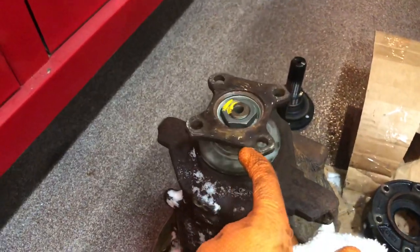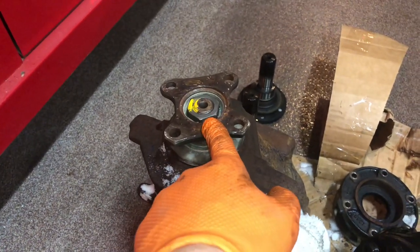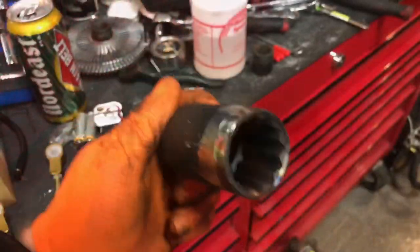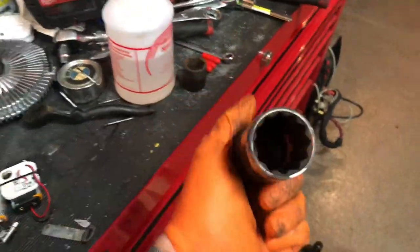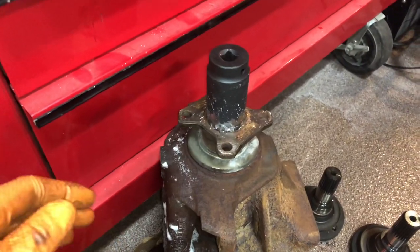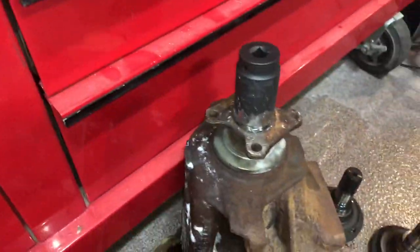Next up, I'm going to yank this out. I'm going to Google it first because I'm pretty sure this is reverse thread, and you don't want to mess that up because this is a crush sleeve and that gets bad. My 30mm socket is a thick wall and I do not have a thin wall axle socket, so I'm going to have to grind this one down quite a bit — Harbor Freight socket. Fingers crossed. Not quite enough, going for a little more. I think that's probably close enough. I'm pretty sure this is lefty-loosy. I looked at the little start thread there and it looks like it's a regular thread. Fingers crossed, hopefully I don't totally bork it.